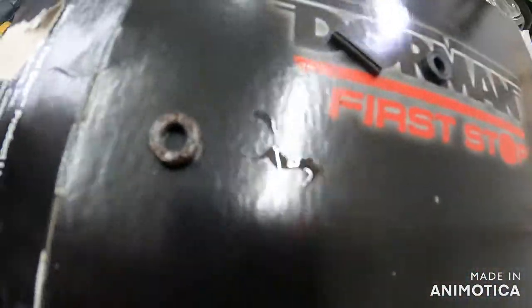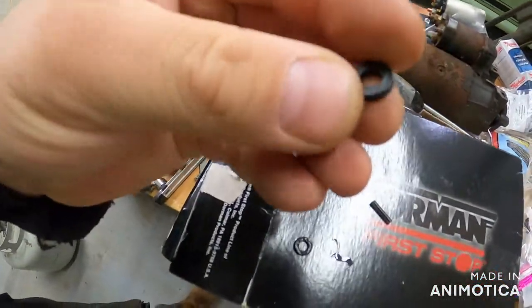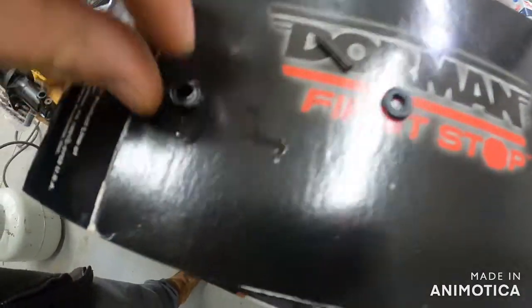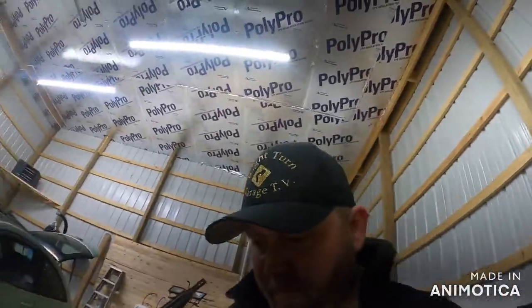There was an O-ring seal in there. On your brand new seal, I was trying to compare and see which side the lip went on the most, and to me they're the exact same. So it doesn't matter. Now, do not put any kind of lubricant on this — you might as well consider this to be brakes, any kind of hydraulic system. You don't want any kind of mineral oil or lubricant to get in there and contaminate it.